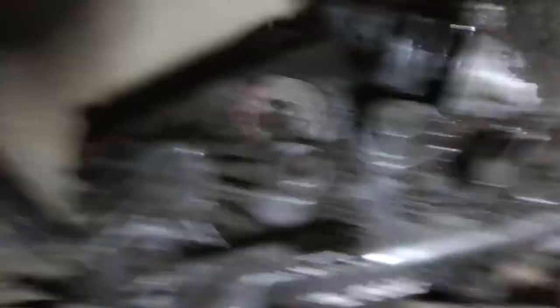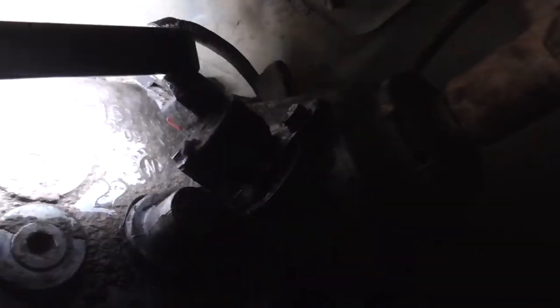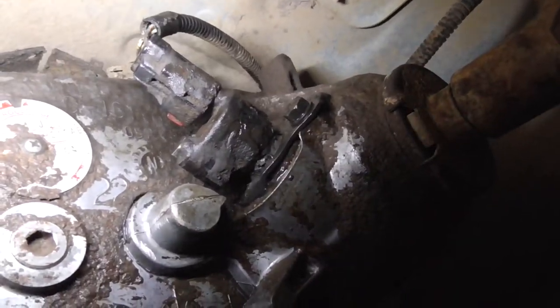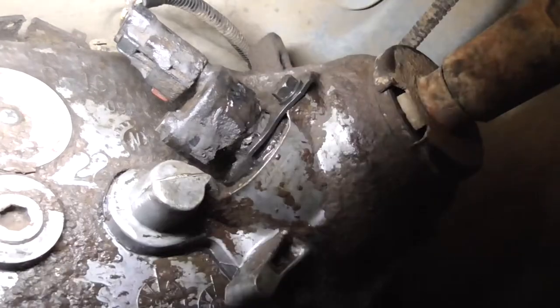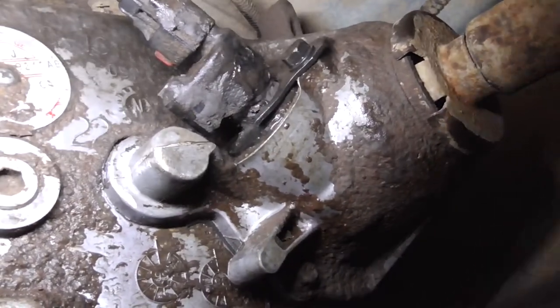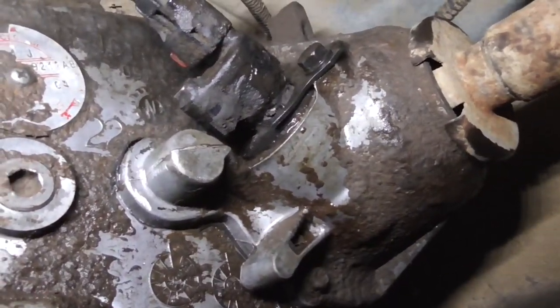After some fiddling, I got it in and it's reading. I ended up having to rotate it — this plug was right here, so I rotated it one click clockwise to get the small gear to mesh. I tried it in all the other directions and couldn't get it, but this one finally read. You just have to get it in the right spot so it's preloading on the output shaft gear, which is why this is adjustable for different tooth count gears.